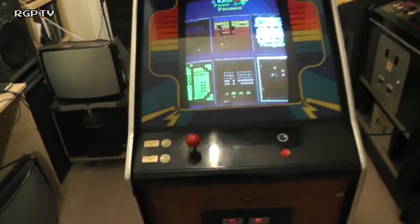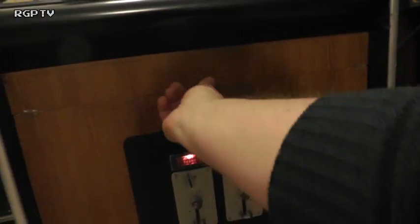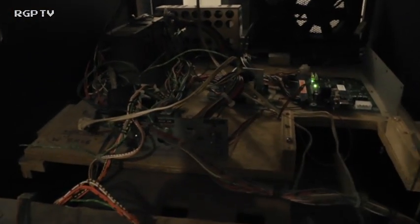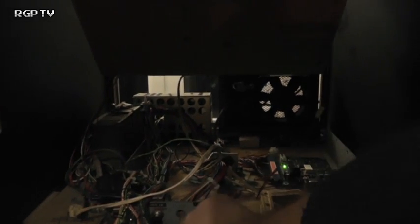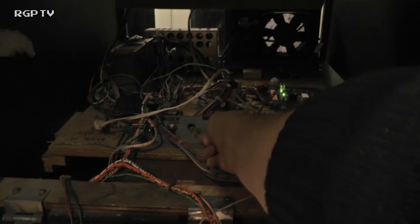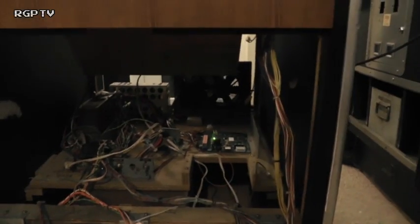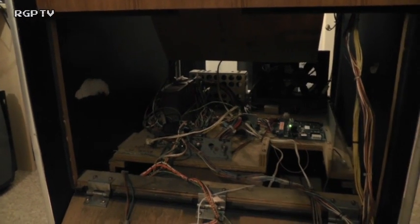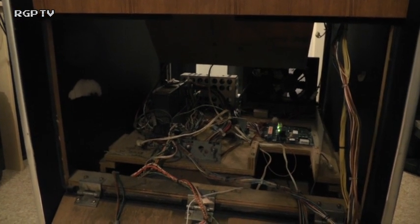You can see it's working. Let's drop this front door down and have a look at what's going on under here. Just release those cables from its clutches - you can drop the front door all the way down. It's got almost like a service panel type thing going on in there: there's a power on/off switch and a degauss button. If you press that one it degausses the monitor. You've also got a volume control, although I don't think anything's flowing through the amp - the volume's all the way down at the bottom.